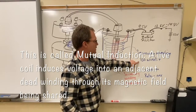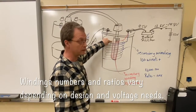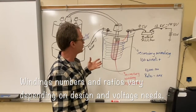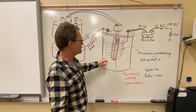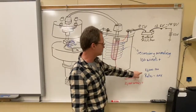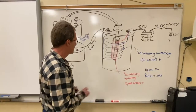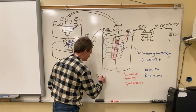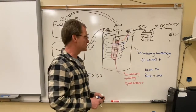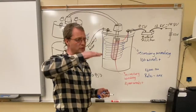We're going to take a ratio here of approximately 100 windings on the primary winding and 10,000 windings on the secondary winding, and amplify voltage accordingly. If we put in 9.5 volts, we're going to get 100 times the voltage out. Just turning the key on, we step from 9.5 volts up to 950 volts at the secondary winding. That's not enough to make it fire yet — it's just an initial surge to 950 volts, and if we didn't do anything, that voltage would quickly peter down.